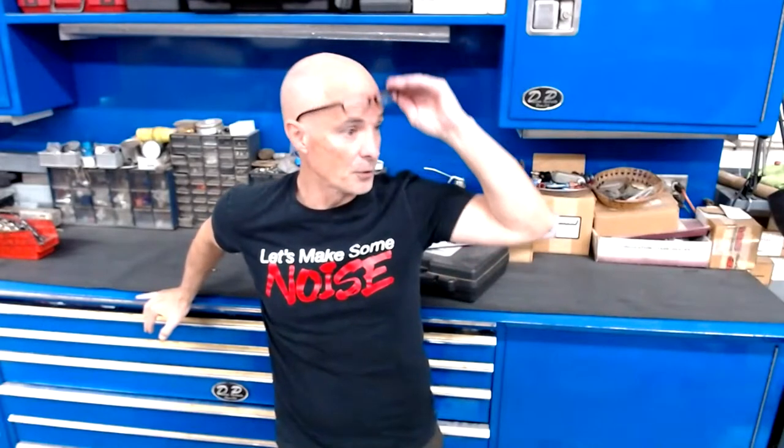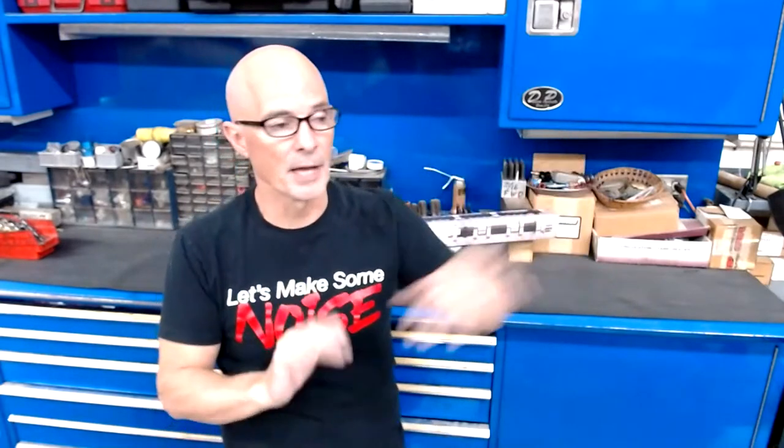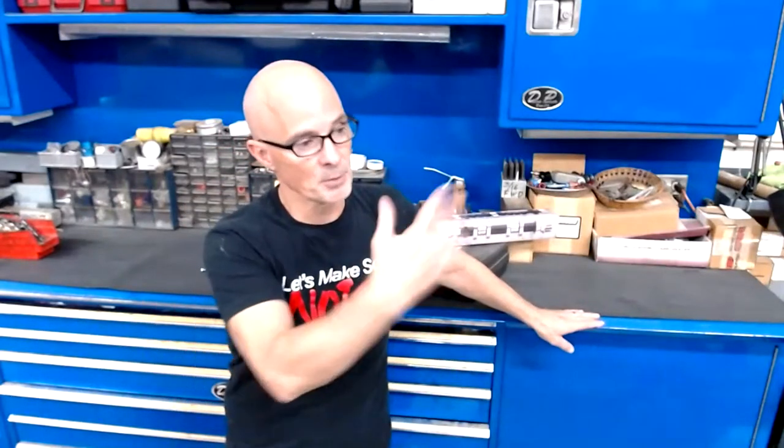So today was a lot of running around. I had to get the gaskets for the 3800. I had to get a blower gasket between the blower and the intake manifold for the L67. I have the one for the other one, for the L32. I had to pick up the bell housing, which was over at Mohovitz's, because I was letting him use the 3800 V6 bell housing as the back half for the adapter plate, as the pattern that goes on the dyno. And then he has the 2.2 one over there. I just took him over a replacement, so I had to pick this up so we could try to run this.